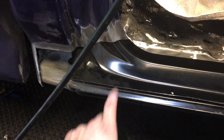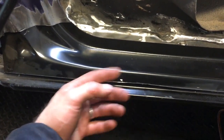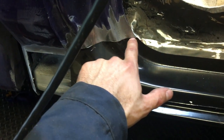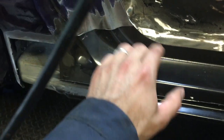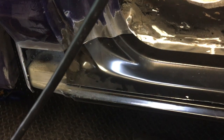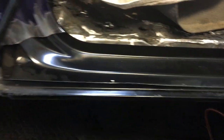I'm going to cut all that, fit it, and tack weld it in place and I'll bring you guys back. Here's this piece — I've removed this little shell piece that can cover this. I just don't want as many layers upon layers of steel, because that's just a recipe for rust. So I cut that off and placed this right here. This is how you get your cut — most people ask what do you measure? Nope — put it here, clamp it, then take your Sharpie and mark it. Then you just cut along your Sharpie line and you've got a perfect butt weld right here.